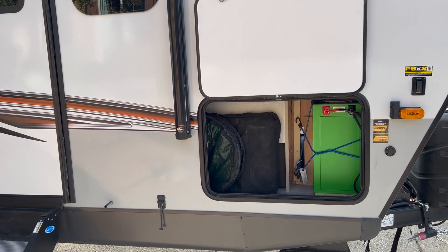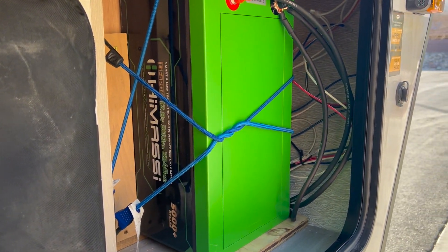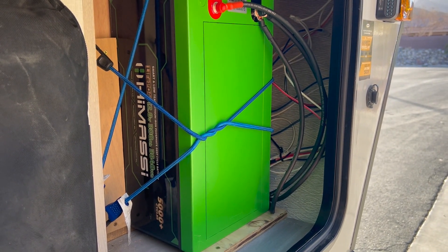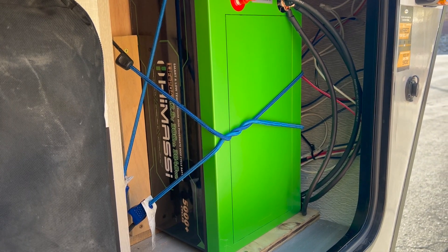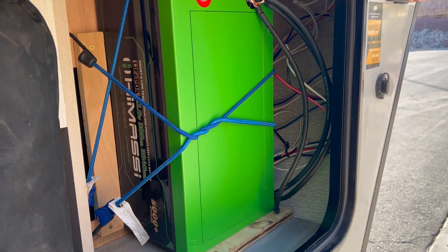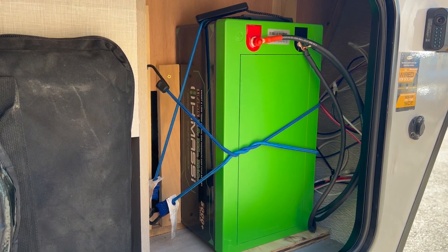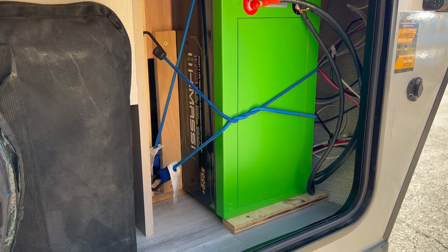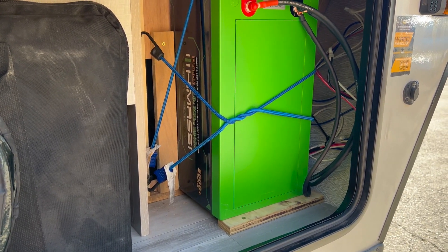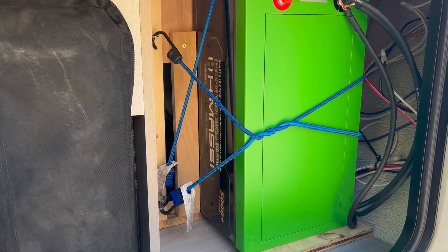The first thing you need to think about when you do this upgrade is what kind of batteries you're going to get. I went with 300 amp hours of lithium iron phosphate. You can use AGM or gels if you want to. I like this because I have more control over where I place the battery, how I place it, and how much I get out of it. The only thing I'd recommend when thinking about batteries is the size — I'm in my late 30s and this 70-pound battery is easy to pick up but kind of a pain to maneuver inside the trailer, so if you don't want to manage all that, you might want to get smaller batteries and stack them.